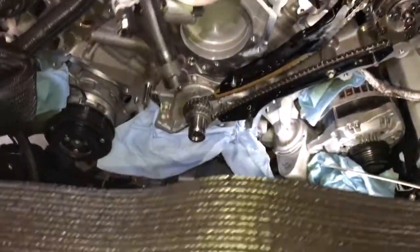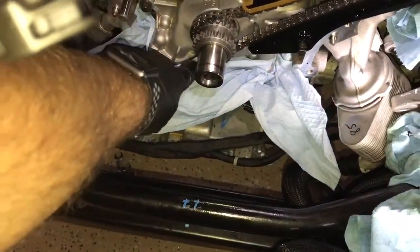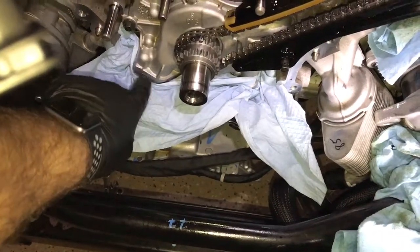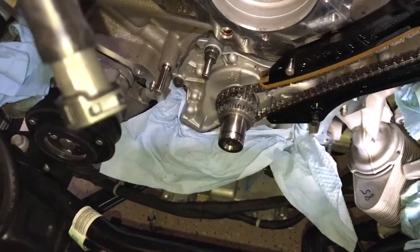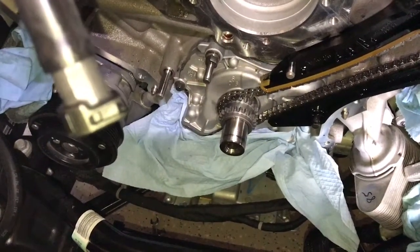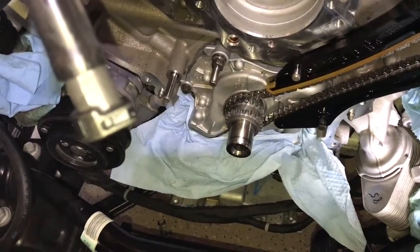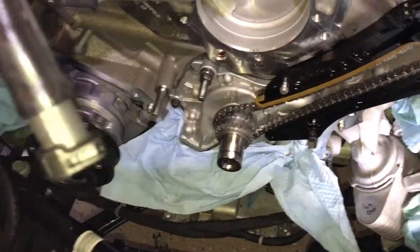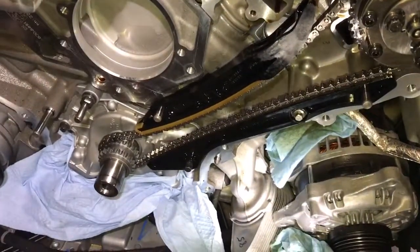A little bit of progress. There are two pump bolts on the oil pickup tube — you can't see them, they're underneath here, going straight into this housing on the bottom of your oil pump. When you replace it, it's a bitch. If you have tools to drop the oil pan and the k-member like a lift and time, it'll probably take just as little time to do that. That being said, 48 minutes of my life wasted on two bolts.